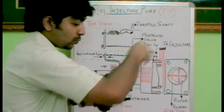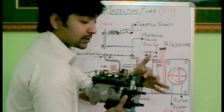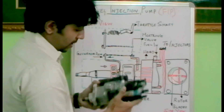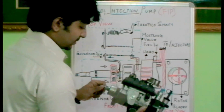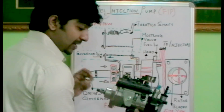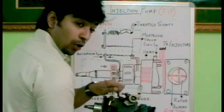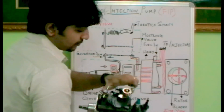This portion is connected towards the fuel tank, which sucks the oil, and these are two solenoids. This is the fuel advance box. This is the drive shaft, where the drive from the engine reaches the fuel injection pump. Here you can see the overflow pipe, and this is the throttle lever.